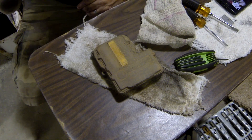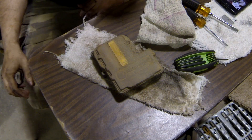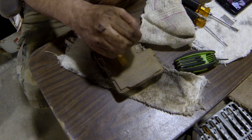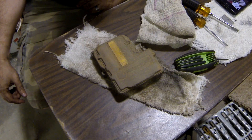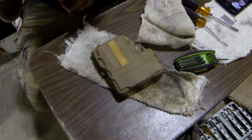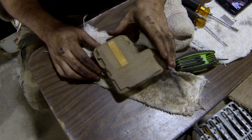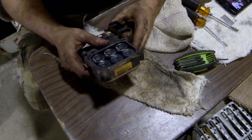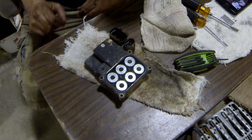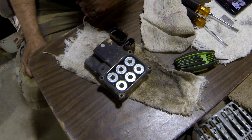It was a tight squeeze — I ended up using a quarter-inch socket, quarter-inch wrench, anything I could. Point of advice: take a small piece of wire or a pick and clean the dirt out of those Torx holes or else you'll strip the heads. I started stripping one but got it out before too much damage. Here it is — Kelsey Hayes electronic brake control module, causing the ABS light and brake light to come on simultaneously. We're going to take this apart and I'll show you what to solder.